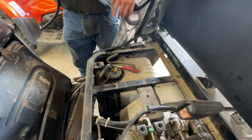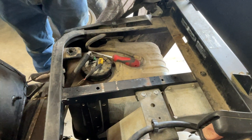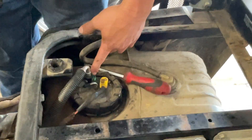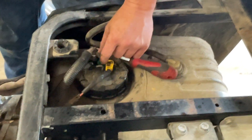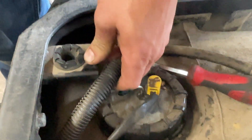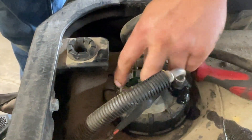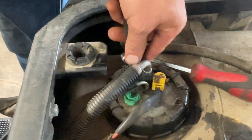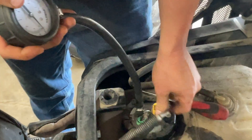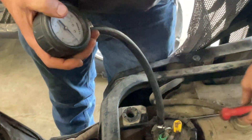The first thing we're going to do is a fuel pressure test on this, because this is a 2013 model and there's never been anything done to this bike. Over here on your passenger side up on the seat, you've got your lock on your fuel pump that you'll pull off. Then you'll pull your fuel line off, pull it out of the way, and slide your tester down on it. I will have a fuel pump tester listed in the description if you don't have one and you're looking to get one.